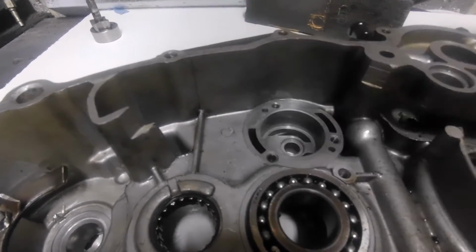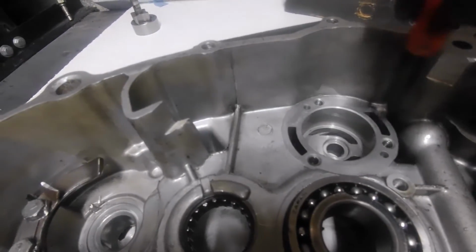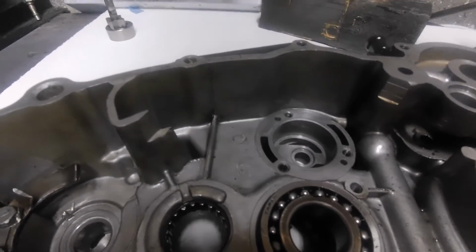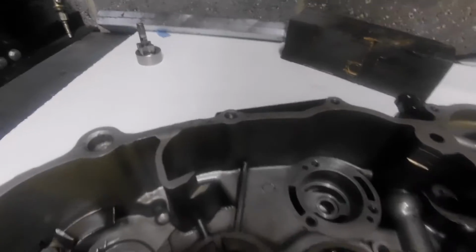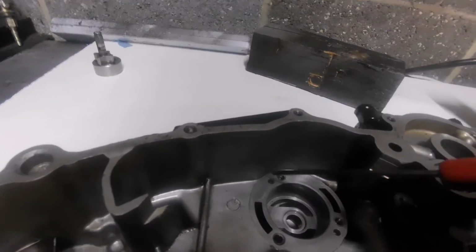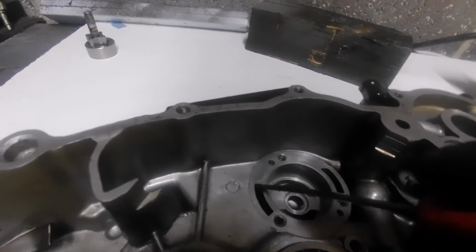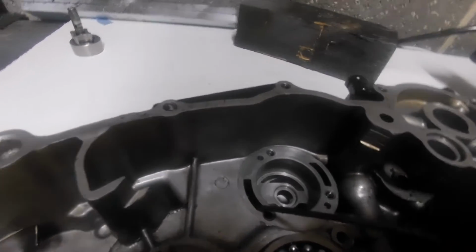This is the inlet for the second stage of the oil pump that goes across the pump and out and into there, into this gallery here, and comes out of here, and feeds the oil filter, and then out the oil filter back up to the camshaft and through here to the main bearings. I know it all perhaps sounds complex, and perhaps I've not portrayed it very well, but in essence, to put it in a nutshell, instead of the oil going back to the tank, the cases have been modified so that the scavenge pump then feeds the actual oil pump that sends oil around the engine's bearings and workings. So the scavenge pump is literally feeding the oil pressure pump.